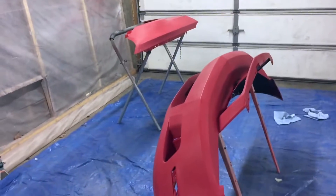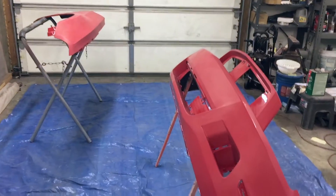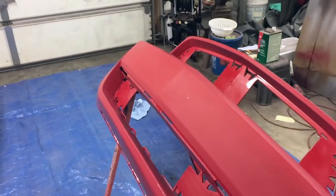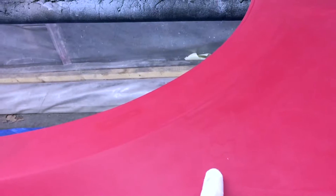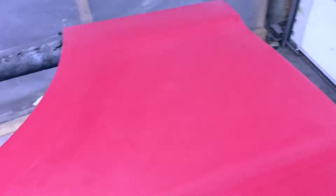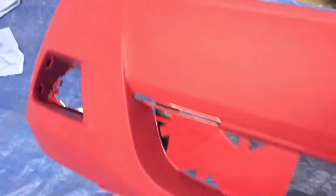Welcome to a new episode of Rebuild It. We're going to retry painting these panels again. I've got all the runs sanded out of the bumper, got it all scuffed up for paint, same with the fender. I have a couple little sand-through spots right here where the red was underneath — hard to see. I'm going to have to blend from about here forward and try to leave all of this the original color so it flows into that door. There are a couple sand-through spots on the fender, and of course the big one on the bumper that gave me the nightmare in the last episode.